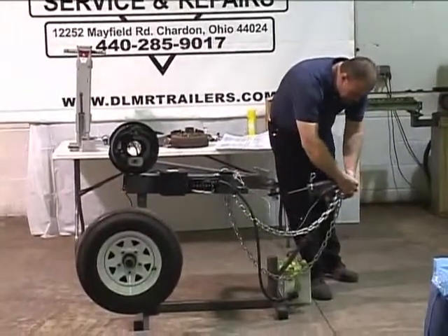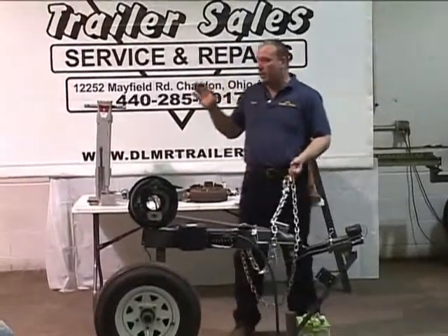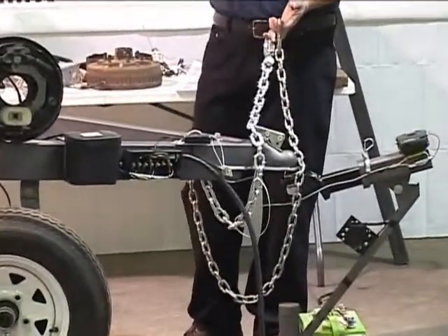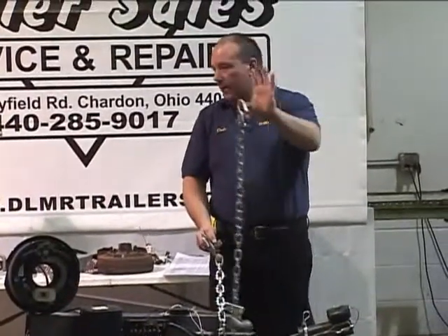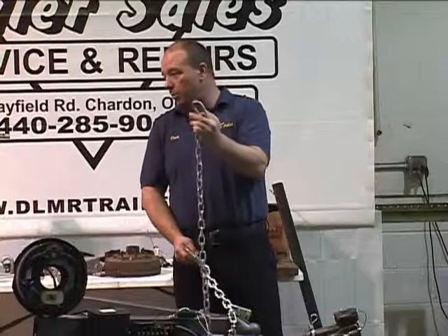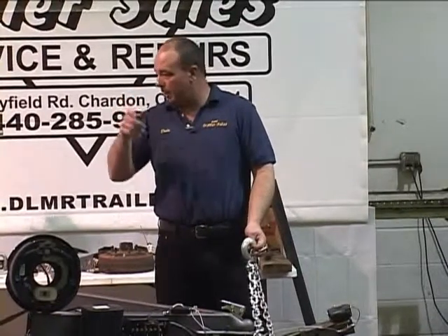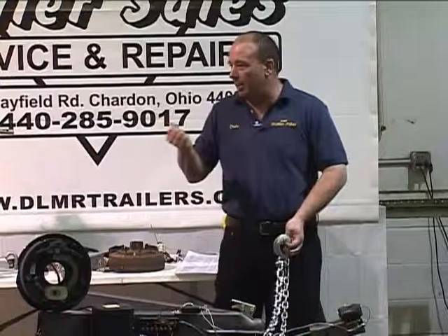Next thing we always check is safety chains. There are usually three different types. One manufacturer uses a cable that's bound up like spring wire — I like the idea because they don't fall on the ground and get tangled, but over time the plastic coating comes off and the cable starts fraying. When checking your safety chains, make sure you haven't been dragging them and worn your links out. A lot of less expensive trailers come with S-hooks — check your S-hook, make sure it's not worn through. Some manufacturers use nuts and bolts; others weld a little rod across and push it through the chain. Verify that rod where it's welded is not rotted out — but pulling on it manually won't tell you anything; you need to visually inspect it.